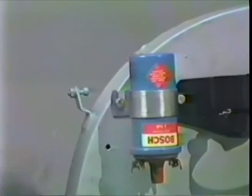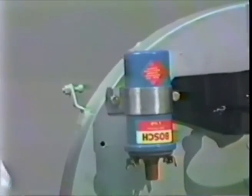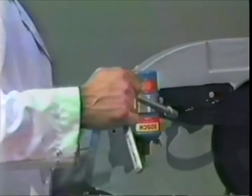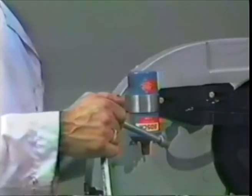Get out a 10mm across-the-flats wrench. Hold the one nut in front of the fan housing. Tighten down this one. Arrange the bracket that's going to hold the fuel line to be vertical. Keep it that way. Tighten this one down. Now don't overdo it, because the cooler's right there. If you over-tighten the fan shroud down, you distort and mess up the cooler.